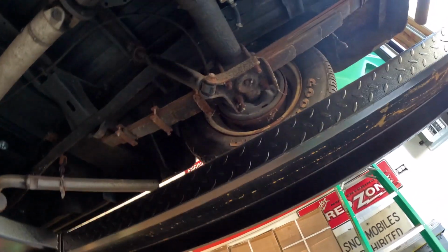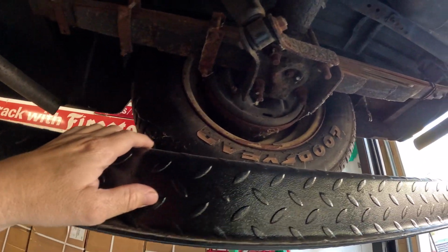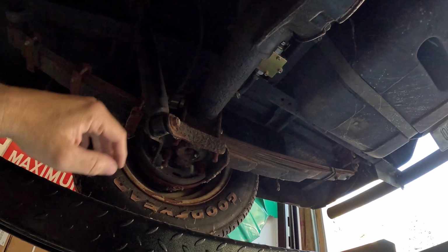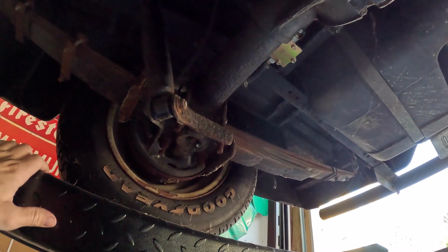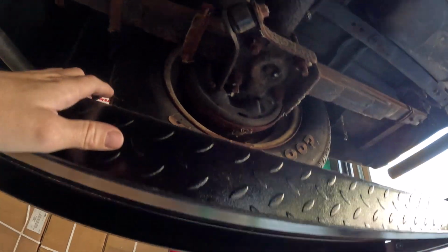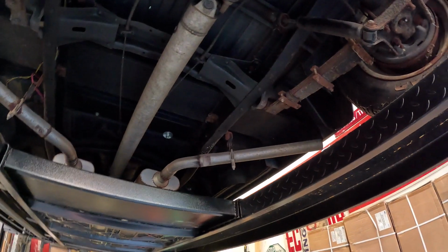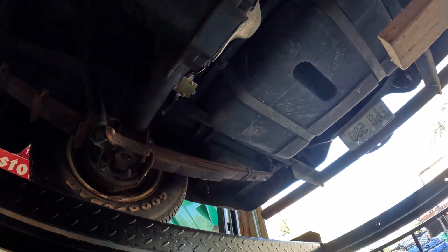But yeah, so if you're wondering how to get some fat top wheels and tires, a nice deep dish in the back of one of these trucks, '94 Explorer, 8.8 drum brake rear axle. I didn't want to put disc on it, so I went with the '94. It was a perfect width, so that I was able to get some nice deep dish wheels on it. I don't remember the back spacing, but I really like the way this truck came out. All right, let's see what I can get done on it right now.